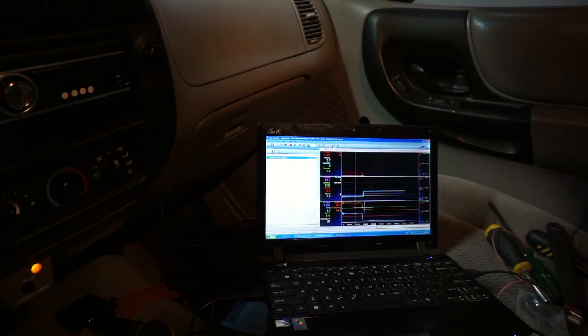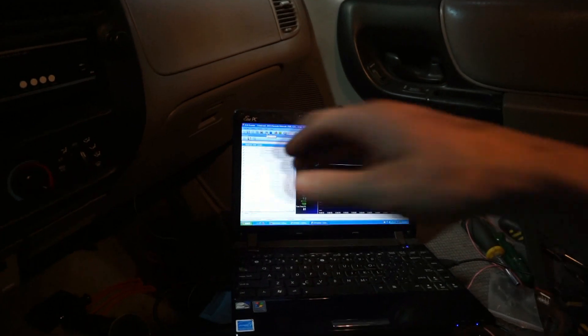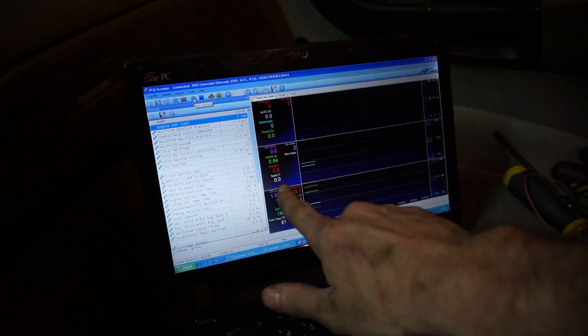So now what I'm gonna have to do is set the timing tables to zero degrees. I don't have a timing light that you can actually adjust for it, so that kind of sucks. I'm gonna try to set the tables all to zero for timing and see if it starts and runs. If it runs, then I'll be able to throw the timing light on it and be good. I'm gonna show you guys this — try to show you in one clip — and start the scanner just to verify that it's settling at zero degrees and watch the spark.